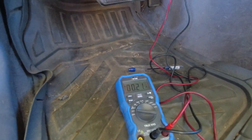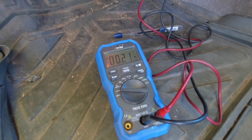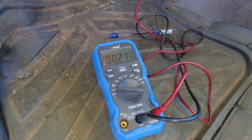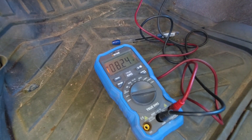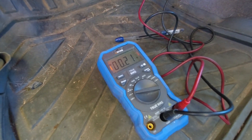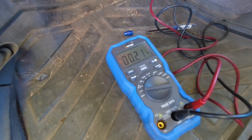Contorting myself into these positions has not done me a bit of good. Every time I stoop down I get cramps in one leg or the other. I've smacked my head multiple times and set my forehead to bleeding - it's just been loads of fun. Still not seeing any movement at all of that lever. Defrost goes to eight volts when I switch to defrost then it quits - like it's trying to change and then fails. Let me swap to the other motor controller wire - dark green motor position - and see if that makes a difference.